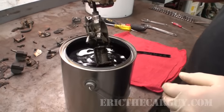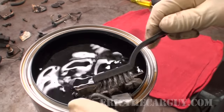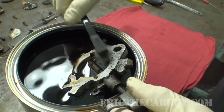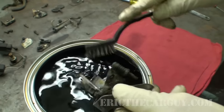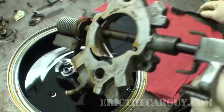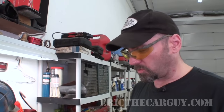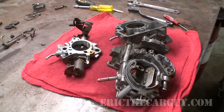We've let our parts sit in the caustic solution for a little bit. There's still some stuff on here, so I'm going in with a wire brush to clean them up a little bit and get rid of some excess gasket material — that's why I waited, because this solution is really good at dissolving that stuff. Just a little rinse. I'm going to do a little more agitation and work to get these parts a little bit cleaner, then jump back in when everything's all cleaned up. Now that we have all our parts relatively clean, I'll dry them off with compressed air and get into the reassembly.